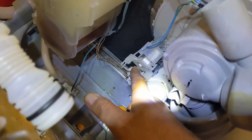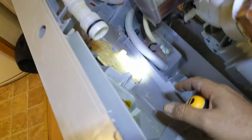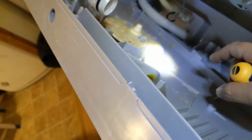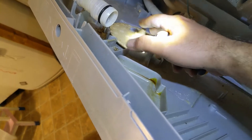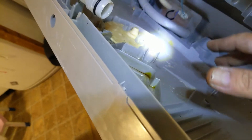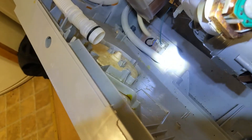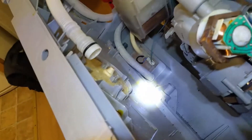The pump and this material push up when water is filled here, and this is pushing this switch. The machine gives error number 15 at that time. So if you have error 15, you know there is water — that's good because you can understand you have some water leaking and you need to open it, clean it, fix it.